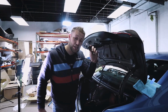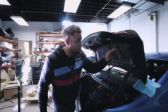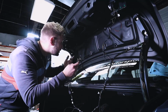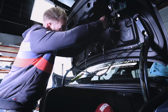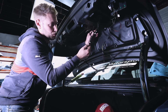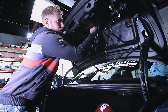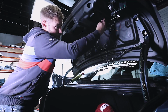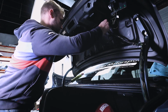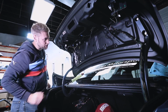Now what you can do is you can take these big plugs and you can plug your tail light in. Now, if you're using OEM, it's just going to plug right in. If you're using depot, there's going to be a little extra wiring. Then you can do the same thing on the other side. What I'm going to do, because this doesn't have all of the proper holes for the plastic mounts here, I'm just going to route everything up through here, just to try to make this as wire-free as possible. And I'll get this, I'll plug it in just like that.